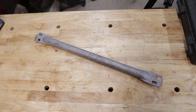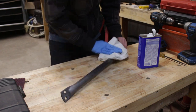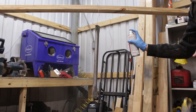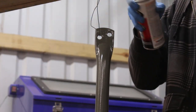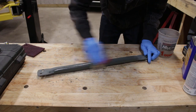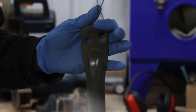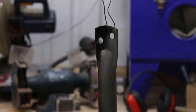The first step for this guy is the blasting cabinet. And after all the rust and paint was gone, I wiped it down with mineral spirits and did what I haven't done too much of in the past, and that's using primer. This is self-etching primer, which is supposed to be really good for bare metal. After a few hours of drying, I gave it a good wet sanding with 400 grit sandpaper, another wipe down with mineral spirits, and then two medium coats of automotive enamel paint.